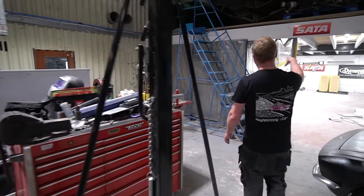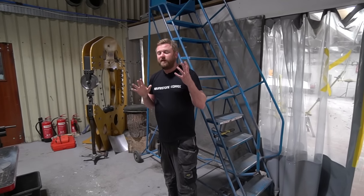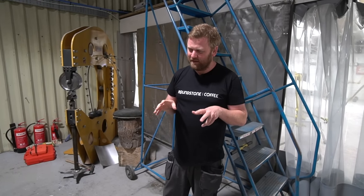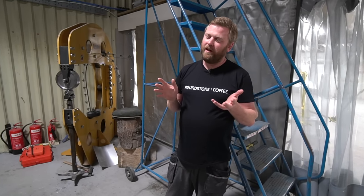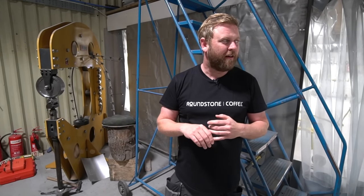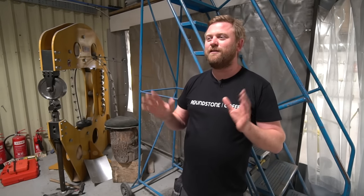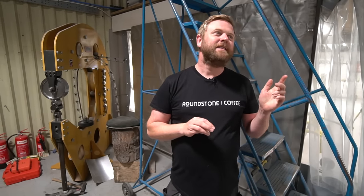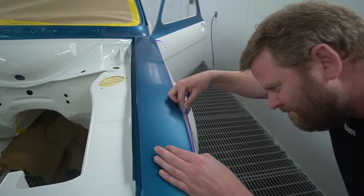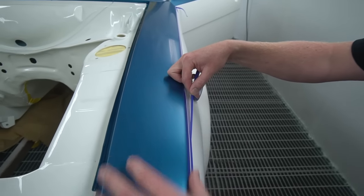The Escort, Project Kuma, is obviously absent at the minute, and that's because it's in the paint booth for me to do the bum clenching masking and painting job. So we finally settled on the colours for the pinstripes. Essentially all of the hand pinstripers I spoke to, and I've tried a couple of people around here, were all a bit nervous about the job because it's a heck of a long stripe, and I know everybody will pipe up and say, oh, the guy at Rolls-Royce does it, because we've all seen the videos, but essentially they were all very nervous about doing it. So I've decided to change tack slightly and go with masking it out and just literally aerosoling in cellulose, and then because we're going to encase it all in lacquer anyway, that will work perfectly well.